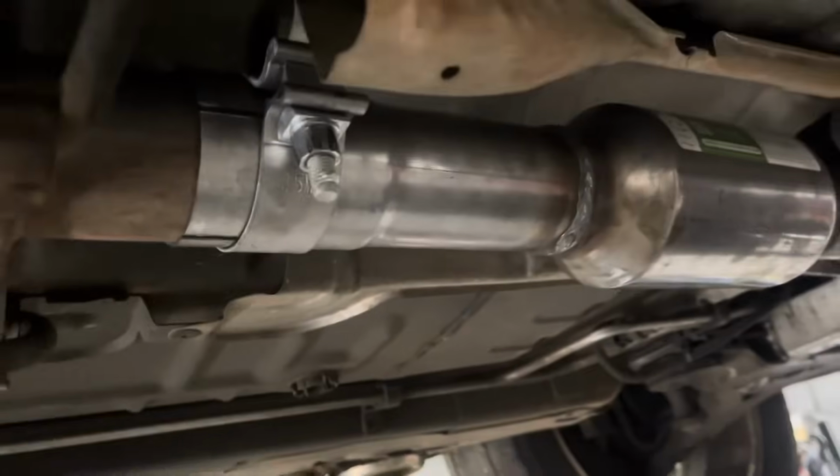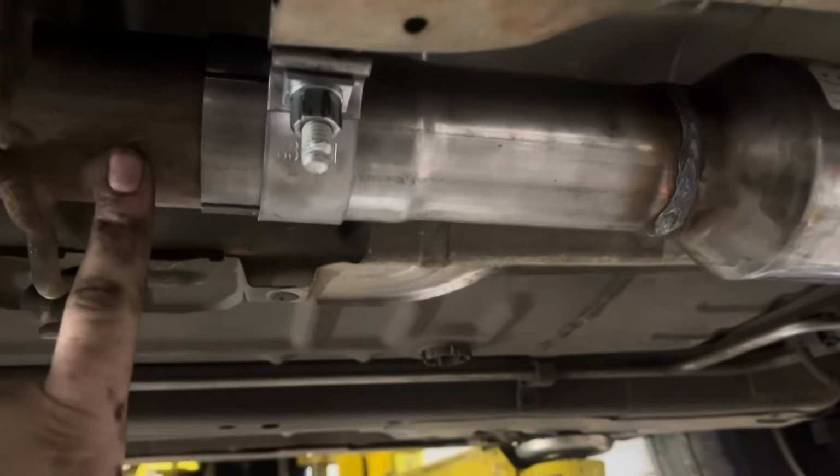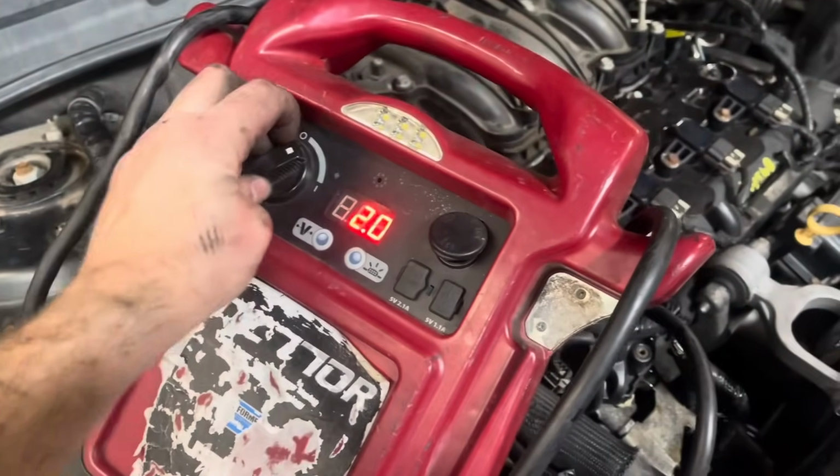One new catalytic converter, 2 new catalytic converters. And here's a tip when you're buying these. Make sure you buy the happy ones. The sad ones don't last as long. But here we go. It's in. You essentially cut the back of the other cat right off where the flange portion of it, like on this one, you cut it right there. And it gives you this pipe, slides over the original band clamp, new gaskets, new hardware. So we're ready to go. Fantastic.